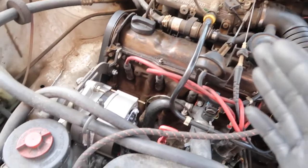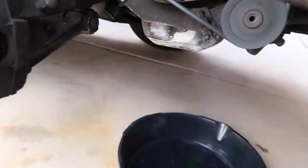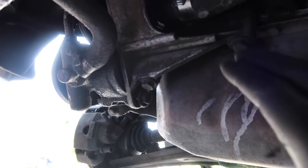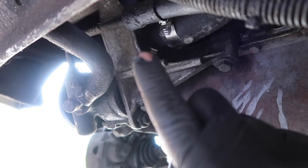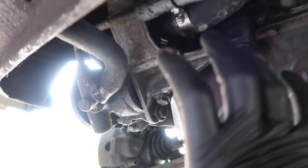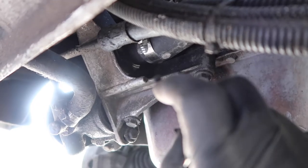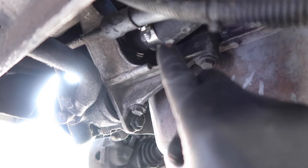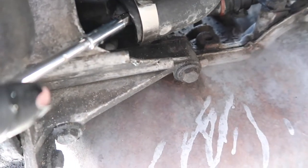All right, car's back on, everything seems to be going fine and we already have some coolant flowing — please do not drink any green liquids from your car, you will regret it. The best way I'm going to attack this is exactly the same way as if I was replacing the thermostat. I have to take off one of the brackets, the power steering line, and then take off a couple of these bolts. First I'm going to get the catch pan and remove the antifreeze from the radiator and make sure it's flushed and not brown or discolored.